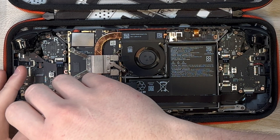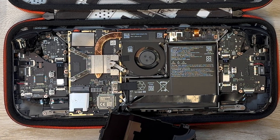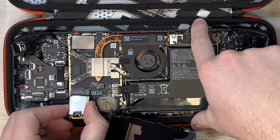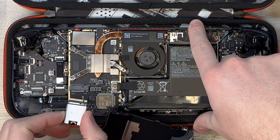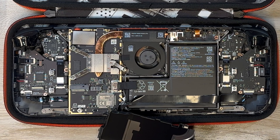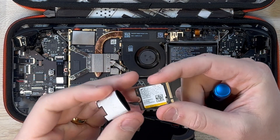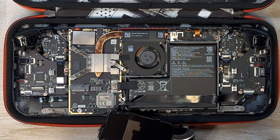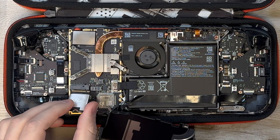At this point you can go ahead and just unscrew the SSD. It's a single screw and the SSD lifts up slightly and you just pull it right out of place. Just gently wiggle it out, and you'll see the SSD does have a little heat cover on there. I personally go ahead and keep the one that came with the Steam Deck OLED just to be safe. iFixit's also comes with their own heat shield cover you can use as well, so whatever you prefer.